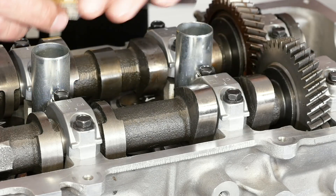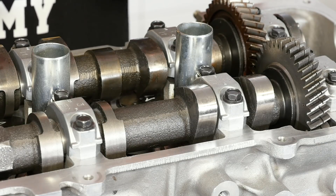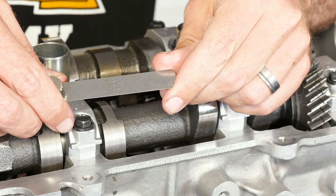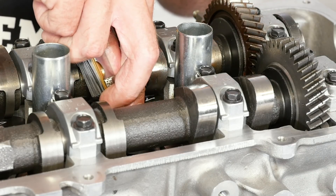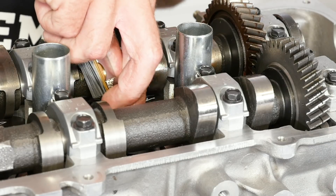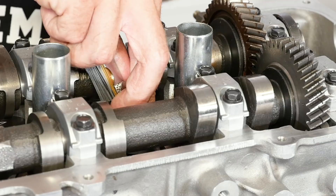So we're going to jump up in size. We'll open up our feeler blades and the next size I'll try is our 12 thousandths of an inch blade. We're going to do the same procedure. Now with my 12 thousandths of an inch blade, I can feel a reasonable amount of resistance. This indicates to me that I'm probably pretty much correct with the 12 thou feeler blade.